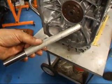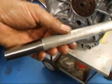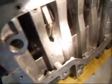My installation tool is about the same size as the piston pin, just a slight bit smaller. I'm going to take the blunt end and stick it through so that I can actually get my connecting rod lined up and get the piston in the right orientation here.